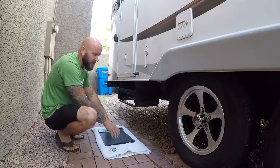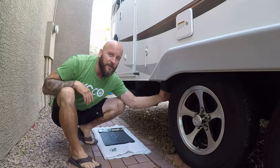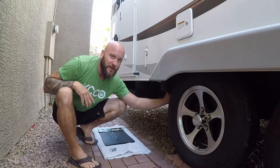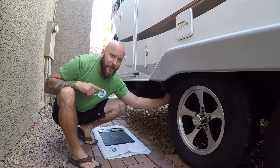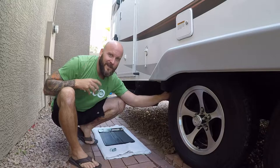Luckily for us, we have a Lance trailer — it's a 2285 model — and we have these brackets that are for the body and attach to the frame. They already have some holes in it that we're going to use, and we've just got to drill one more. So it's going to make the install pretty easy for us. Obviously with your trailer it's going to be something different, but we're just going to do this quick upgrade and drill one hole. I've already stepped up the bit a couple times to the size of 3/8ths.